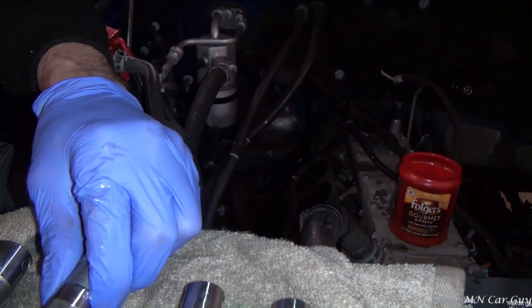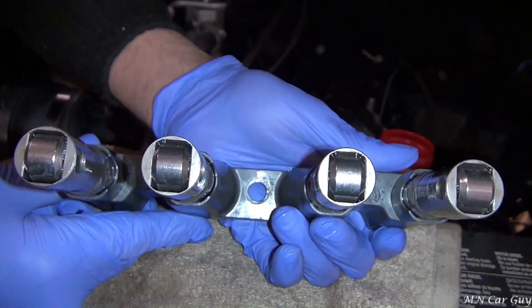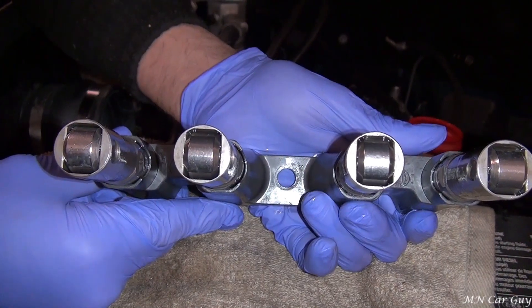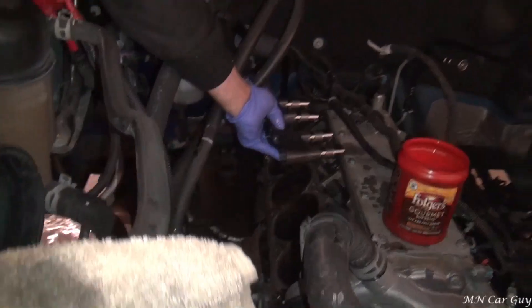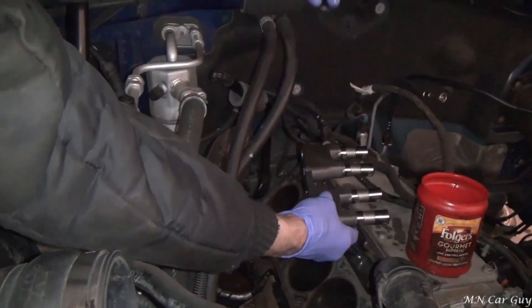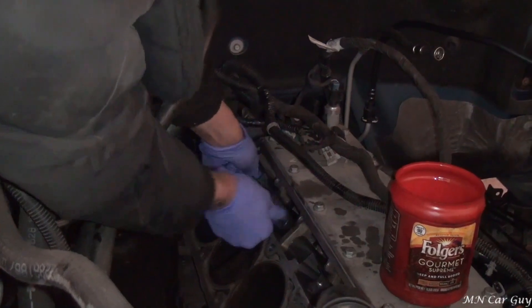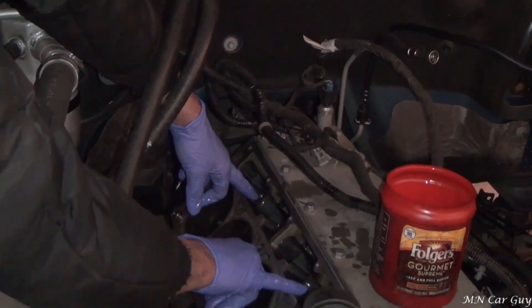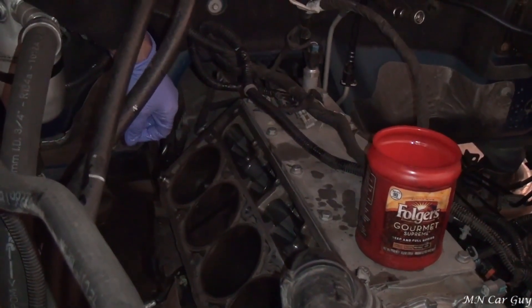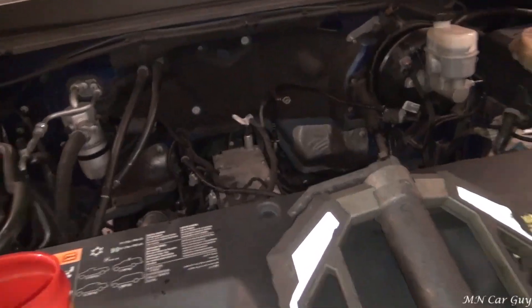The plunger side obviously will go inward. There's a flat surface on the inside of this tray hole that allows for proper orientation of these lifters so they can't turn in their bores and ride on the cam incorrectly. We made sure that everything was lubed — this back one is kind of a pain to get to. Wiggle it to and fro and she'll go down into position. We'll put the 10mm bolts in here to hold these in place. Both head gaskets are in place, ready for the heads to install.